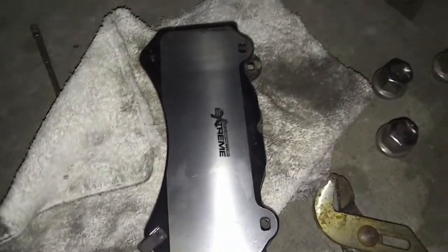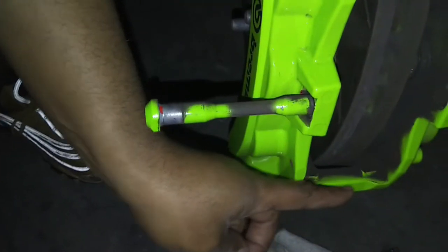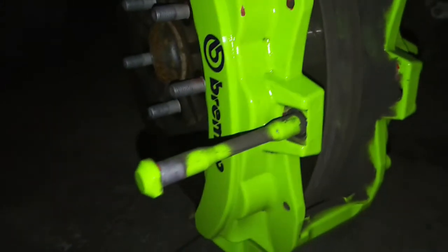We also have our packet - this is going to be for the back side of your brakes. As you guys can see, this oil goes on that back side, the shiny part, so those pistons in there can grab a hold of them. I'm going to wipe all this down before I attach everything back together, wipe my pins off and what have you. We'll wipe all of that off on the inside here as well. We'll put our sauce and lubricate everything up there and make sure that everything is well lubricated so that everything goes back in accordingly.